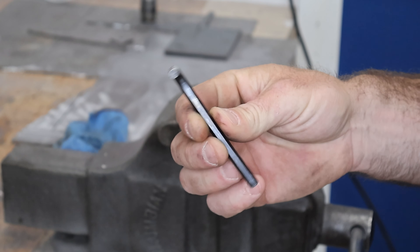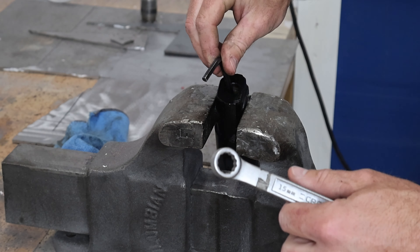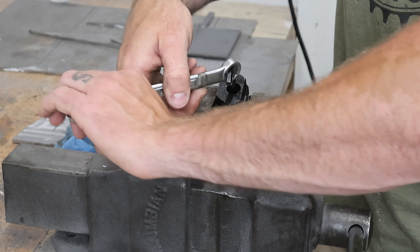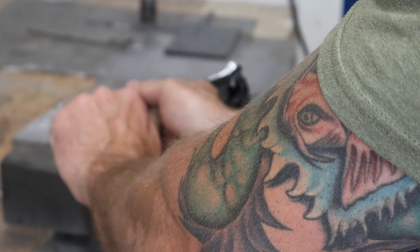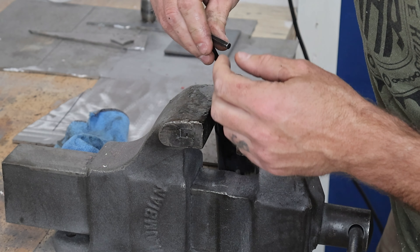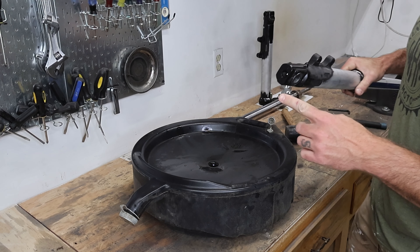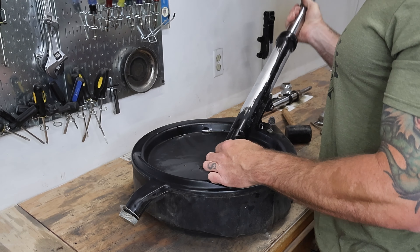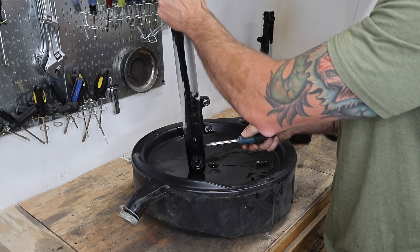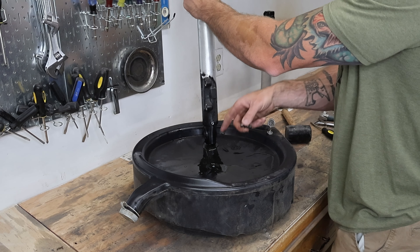To get this out I've got this Allen key here. I'll show you a trick to get this out using the addition of a box end wrench. So we put the Allen key in and I'll take the box end wrench, put it over the top like this — it gives me some more leverage. Got that broke free. Now that's just going to come out. With the bottom loosened up, flip this over and that's going to fall out. Don't drop it in the oil pan. I'm going to take this little drain screw out and that'll allow the fork oil to come out a little easier. We'll let it drain.